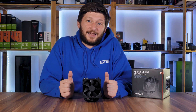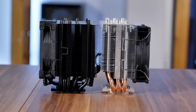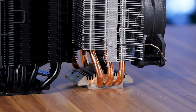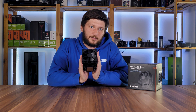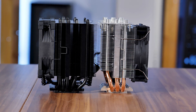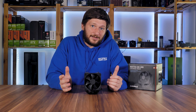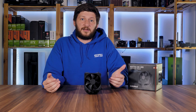If we would assume that both fans are performing exactly the same at a given fan speed, it makes complete sense that at 100% PWM the Noctua is a bit cooler while the Be Quiet is a bit quieter. But what doesn't make any sense to me is the absolute performance that the Noctua brings to the table. Sure, both coolers are generating pretty respectable results concerning their size, but the Noctua comes with 5 heat pipes while the Be Quiet only has 3. I was expecting that the NH-U9S would completely knock out the Pure Rock Slim 2 just because of that, and considering that compared to the Pure Rock Slim, the heat does not have to travel that far to get to those fins. But in the end, both coolers are pretty much equal — one is a degree cooler, while the other one is a decibel quieter.